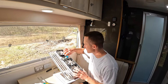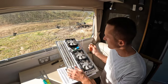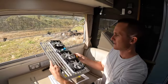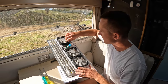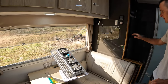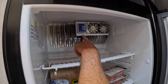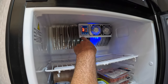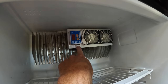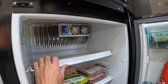Here's the external vent - I'll switch this to the testing position. That's working, and there's a little blue light visible from the outside. I'll turn that off to make sure they're working independently, because if wired in automatic position, when the external is off the internal fan won't work. Coming inside, in the off position I can turn on the LED and the fan comes on - or I can have just the fan running without the LED. I'll double-check the thermostat is set at the right temperature.